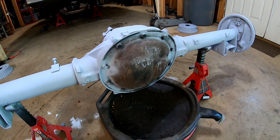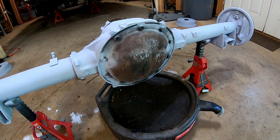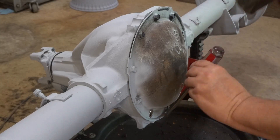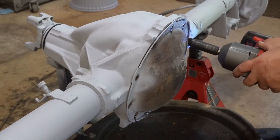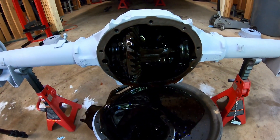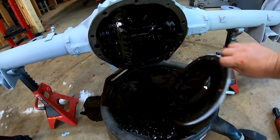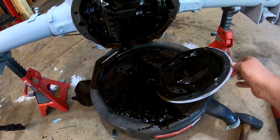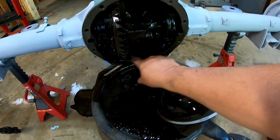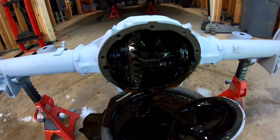While I'm thinking about painting, I'm tempted to knock that cover off. I didn't do anything to the cover since I'm replacing it anyway. I'll take it off, let the oil drain out, and see what the gear ratio is and what condition the gears are in after 43 years of service. That is some pretty black oil — I'm guessing this hadn't been changed for a while. I can feel some grit down there, but no chunks, so that's not too bad. Really dark — probably well overdue, but it doesn't look terrible.